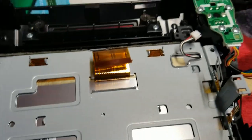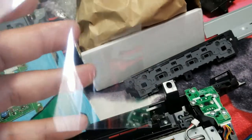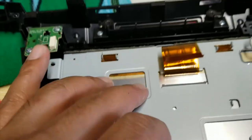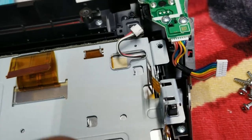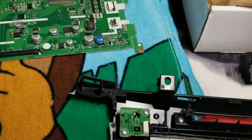So, before I go any further — there was a secondary film on the actual outside of the glass. Now it actually looks like a nice clean glass. What gave me the idea was, if you look closely, there's hairline scratches in the actual film. I was like, hmm, let me see if this thing actually comes off. And it does — it's just a protective film. So that goes away. Angle it topward in a little bit — everything lines up. You've got alignment tabs. Make sure the ribbon's out of the way. Now we move on back to the board and put everything back.